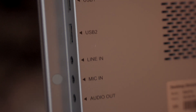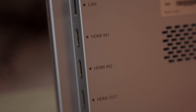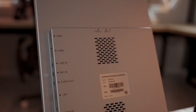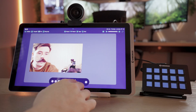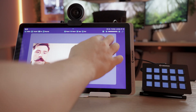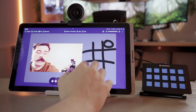This device has HDMI pass-through, so as you're gaming, you can not only capture your footage and record your footage, but then have it pass-through to your monitor so you still have a good and smooth gaming experience. The Submerge DSA does capture in 1080p, so if I was gaming in 1080p, I would just be using the pass-through. But if I was gaming at a higher resolution, I would just plug into the input, set it to mirror my actual display, and come out of my GPU in two different spots — a pretty cool feature.